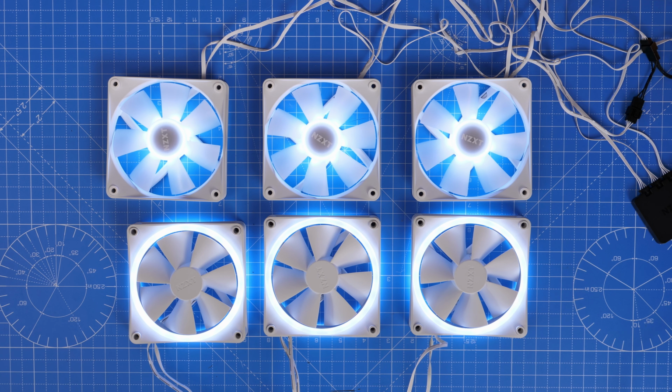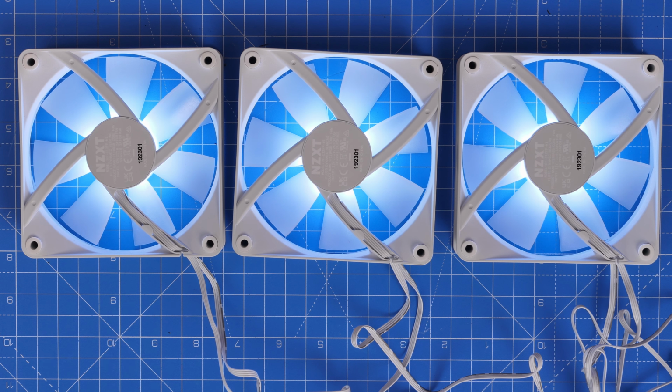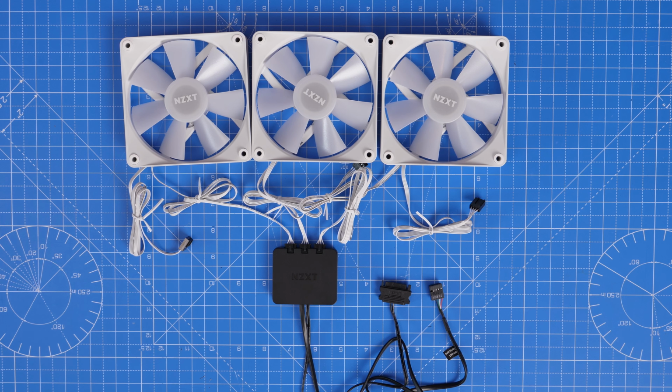Now, NZXT also has a similar logic. However, both NZXT and Corsair use proprietary connectors, which means that you need an NZXT controller for NZXT fans and a Corsair Commander for Corsair fans. So it can get a little bit complicated, and there are their own caveats to those. So I've done separate wiring guides for both Corsair and NZXT that I'll link to in the description, but I'm also going to quickly give you an overview of them a little bit later in the video